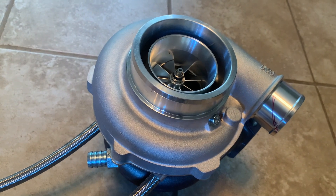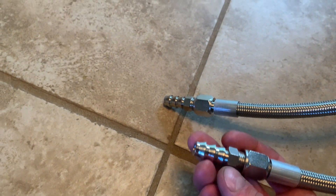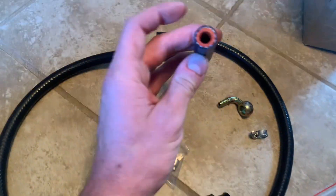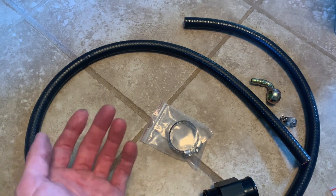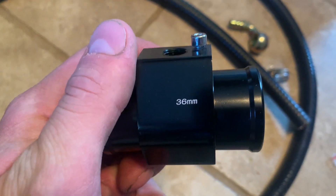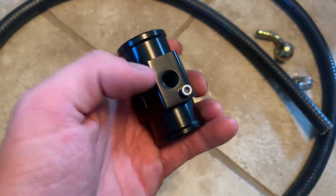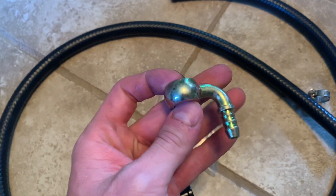I'll have another coupling that connects and goes up and over the subframe — I'll have it in the description. These AN lines are just off eBay, pre-made, and they come with adapters for barb fittings. I will not be running all AN lines for my cooling — it's just not necessary. This is the Vibrant coolant hose I use. I use this on my red car — even the 7/8 inch Vibrant coolant hose for all my heater lines under my manifold. It's affordable and it's not super cheap — you don't have to worry about it failing.